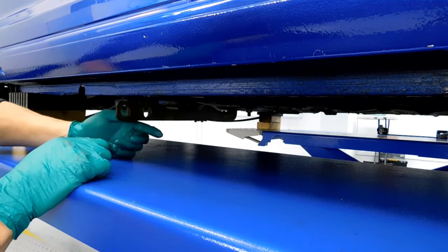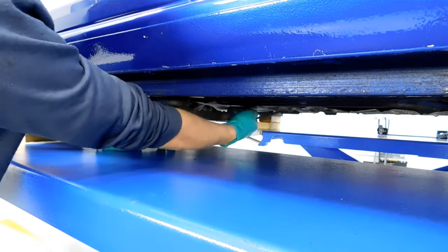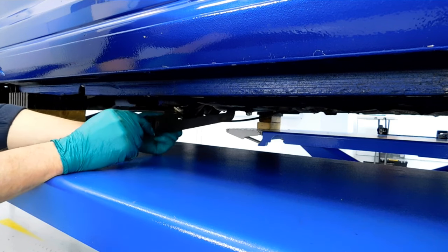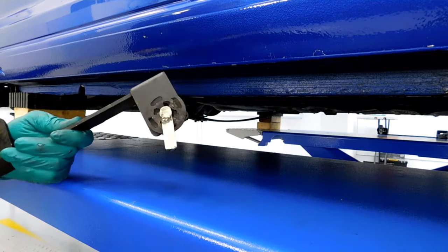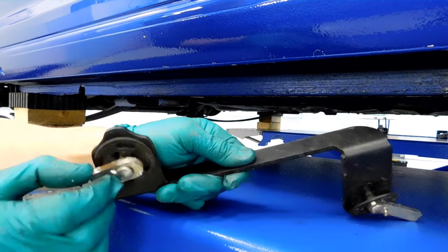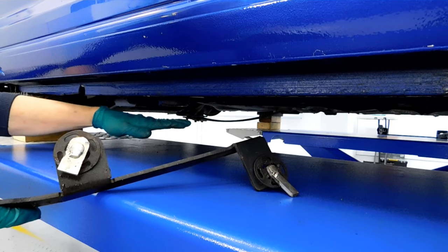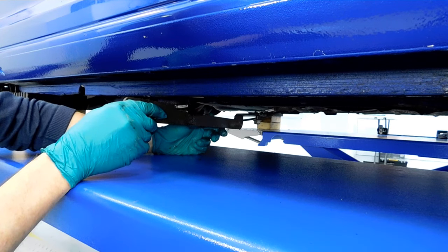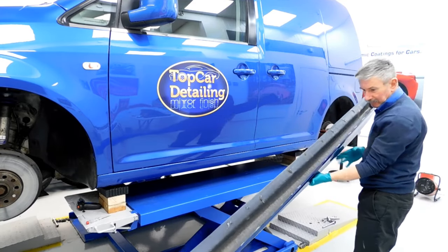You can make it out here — we've got the bracket and you can see how low it's hanging underneath the van. We can unscrew these and get them out without having to cut the bolts off. All that's holding these on are these T-pieces here — they slide and slot underneath. In the holes underneath the vehicle we've got some rubber grommets we're going to put back in afterwards, but we're getting rid of these now because they're fouling on speed bumps.